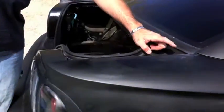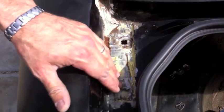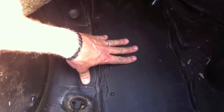I'm zooming in right here, and right over here. Ford puts in a pool of sealant in here. So when you look at your hinge, you'll see it's basically pulled right over — you barely can see the hinge. Water was coming into this trunk through these bolt holes and it was not obvious. What had happened was underneath the carpet rotted out and we had to cut out the rust and put a metal plate in here.